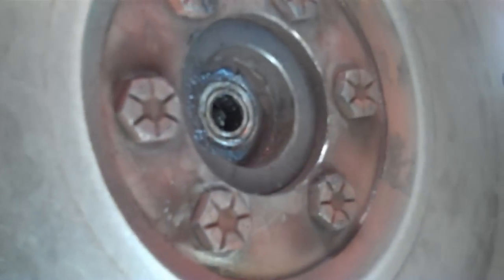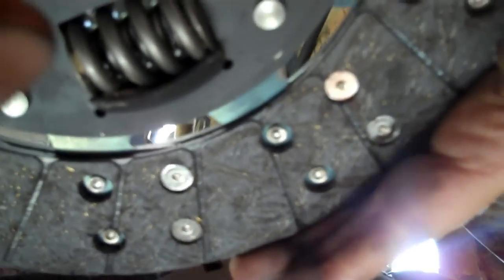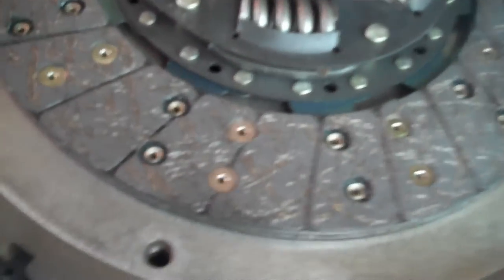Pilot bearing is set. Now we've got the alignment tool. Look at your clutch plate — this side says 'flywheel side' right here — this goes against the flywheel. Your alignment shaft goes through the splines, slide that through, then come up here and line it up. That shaft has got to go right inside that pilot hole. Once you get it set, it'll slide right in and the clutch plate is centered inside the flywheel. Then take the pressure plate, set it up over the top of this, and get the holes lined up.